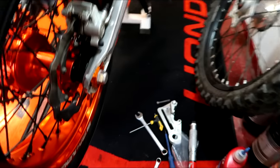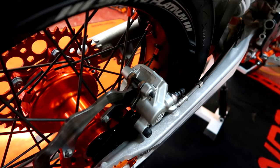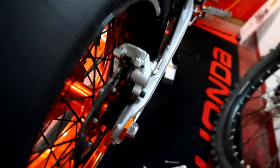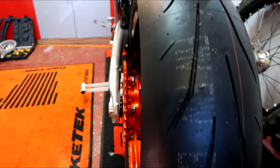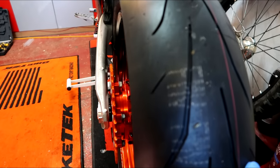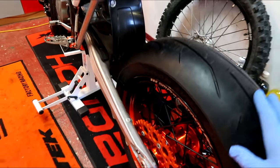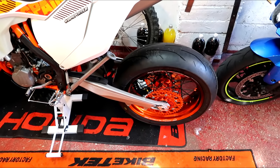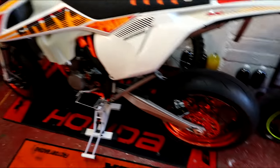I just hope I don't have to take it apart again now. Now it's in, I want it to stay in. SM Pro wheels are just absolutely gorgeous. It looks also like — I was a bit worried about chain rub because sometimes when you go for the 160s the chain can actually rub on the edge of the tyre through here, but I think we're okay. So the next job really is to fit the chain and then it could actually be test-ridden. I think I'm going to have to re-bleed the back brake again, but it's finally taking shape.